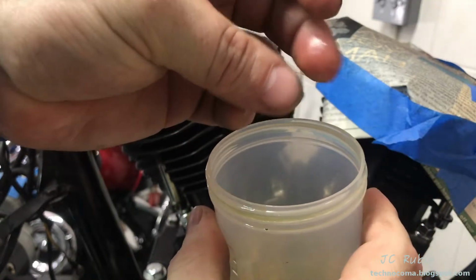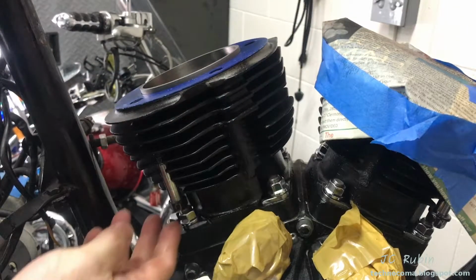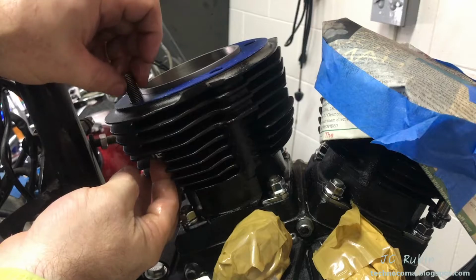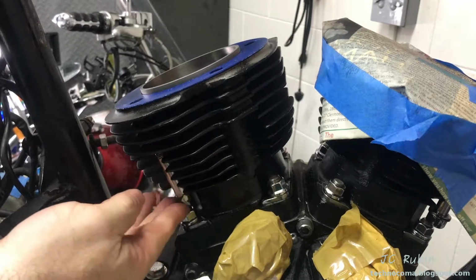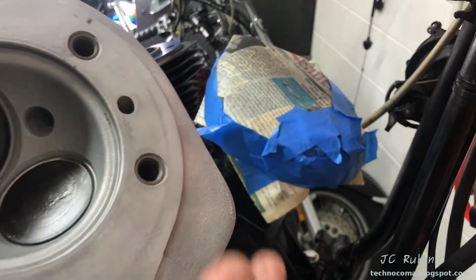I had to do a retorquing procedure, but you'll see later in the video that's just going to appear with the washer back in the correct position, not in order in this video, so it looks a little bit strange because I hadn't realized it yet at this point, but I am applying oil to the bolt after I had secured the gasket into place. The mating surfaces on the bottom of the head are re-cleaned one last time.